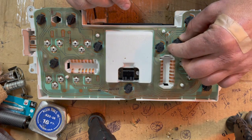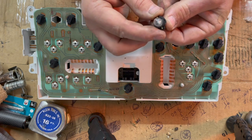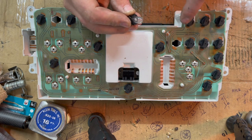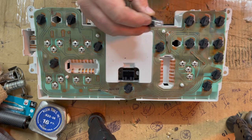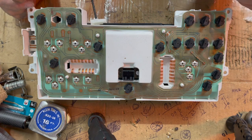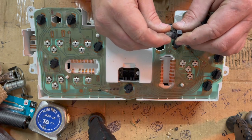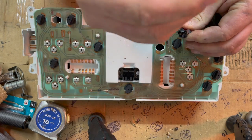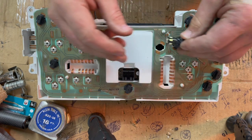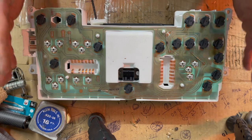Let's start by removing one of these — it's just a tiny, not even a quarter turn. You pull the bulb out; they're held in place by little copper tension tabs that dig into the copper on the printed circuit board. When you put it back in, line it up and make sure those tabs are touching copper — they pretty much only go in one way. Pull the bulb out of its holder, grab a new LED, press it in, put it back in, and that's it.